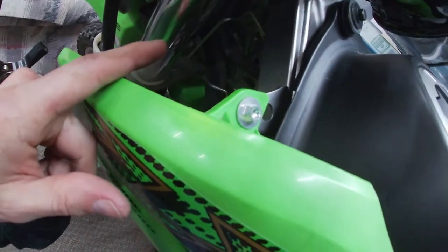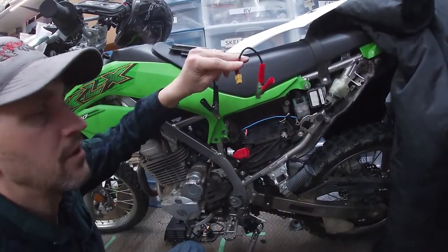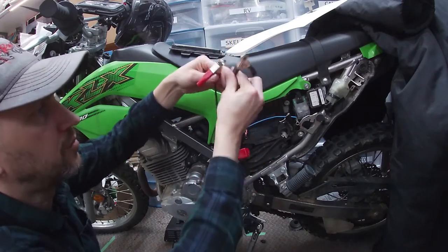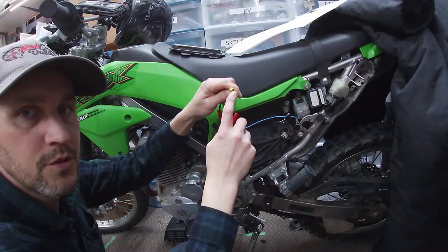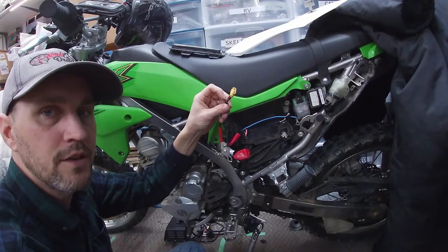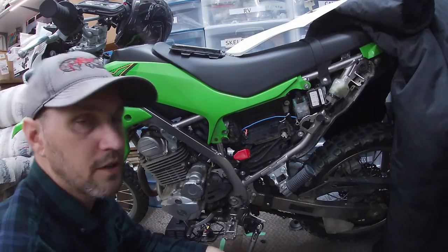Up through here is our loom, and now we've got a 12-volt XT60 connector here. We can use it with something like jumper cables — I could plug this into my bike up at the dash and hook it onto someone else's battery and boost. Or I can plug in a portable 12-volt power supply, like a three-cell RC lithium battery, to boost the bike. So now you have all kinds of options — you can carry a little tiny booster pack and just give the bike a go whenever you need to, without having to take everything apart out in the woods.